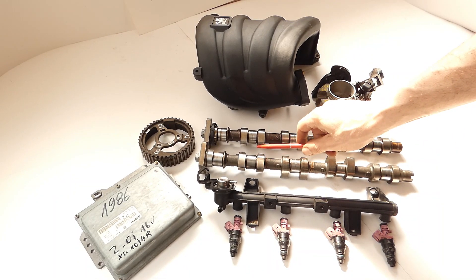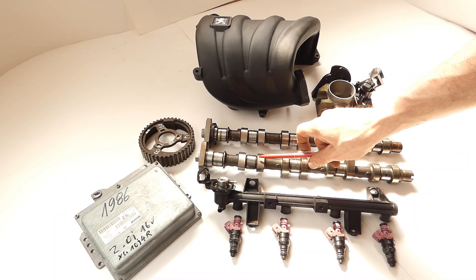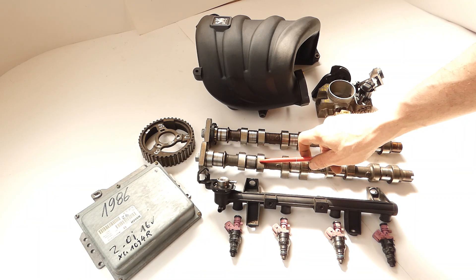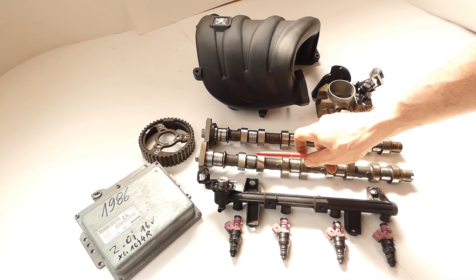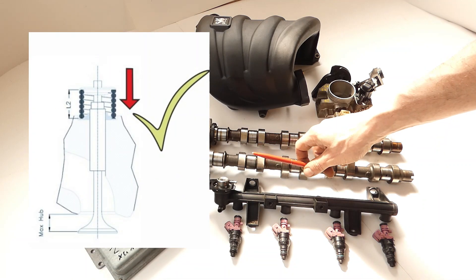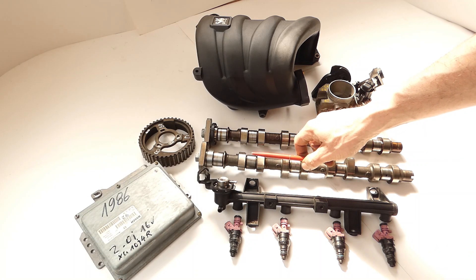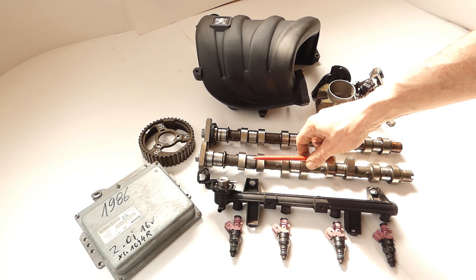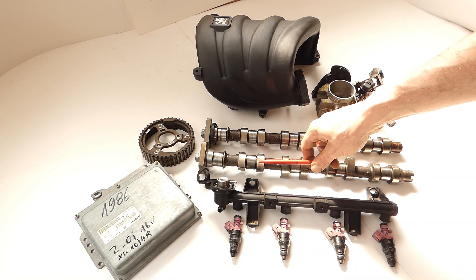On the topic of the XU10 J4RS camshaft: the 10mm lift is guaranteed - meaning the valve spring has enough reserve and when turning through the camshaft the valves do not go coil-bound. I have already tested this and it fits. Structurally they must be identical, at least in terms of dimensions, possibly not in terms of the forces they can handle - but I will research that further and report back.